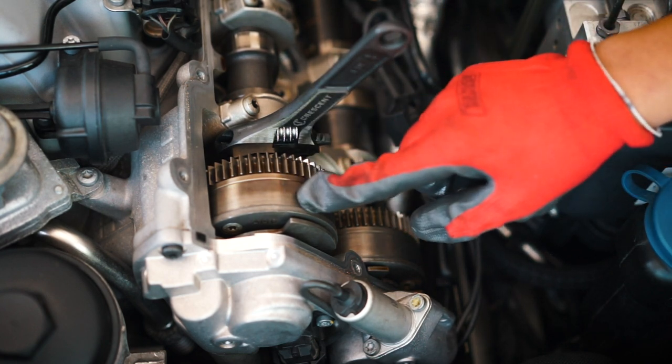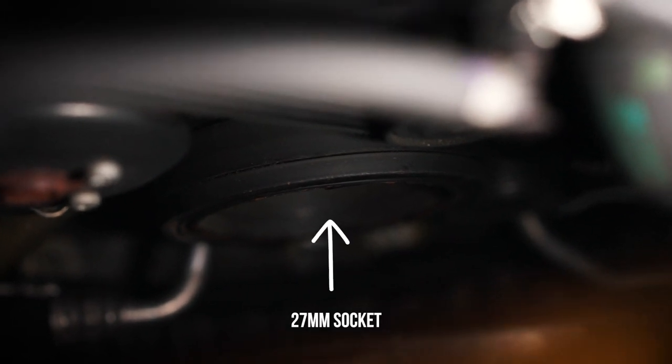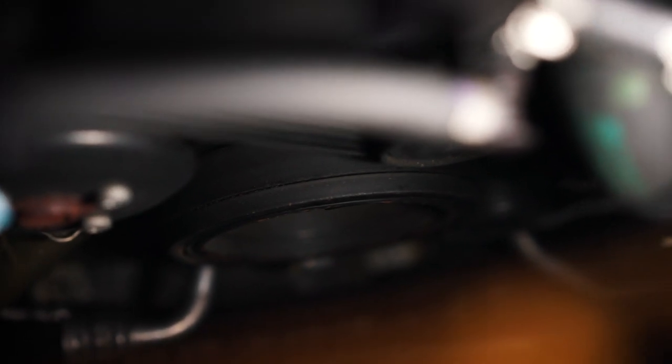So let's get started on getting this off. So now that we know that this one's bad. All right, so the next part has to do with turning the engine to a 40 degree mark on the crankshaft. So right there is where you would have to put a 27 millimeter socket on and turn the crankshaft